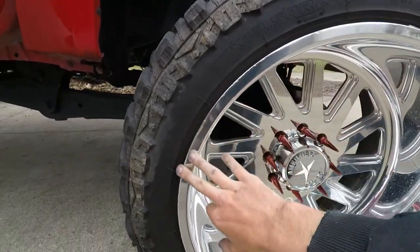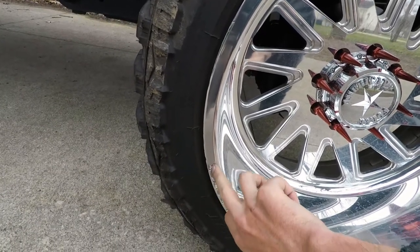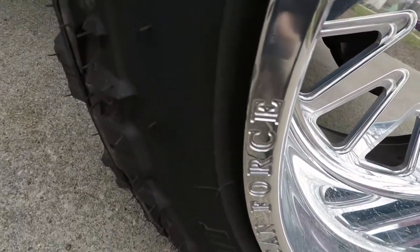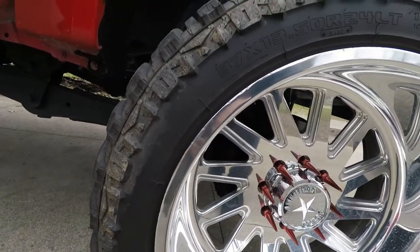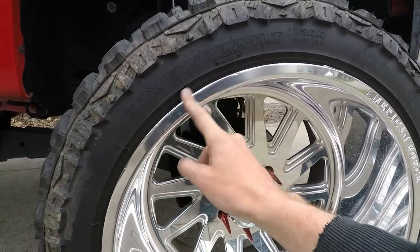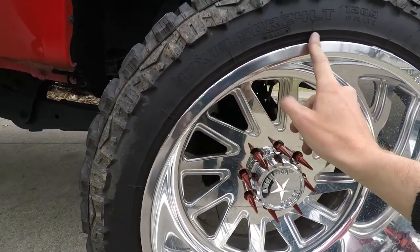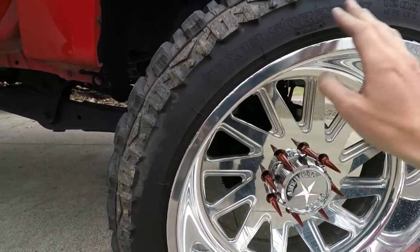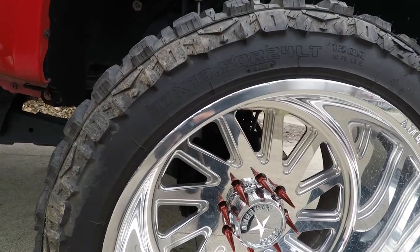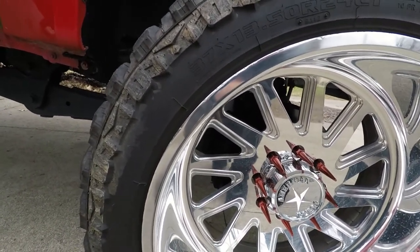You can see I curbed these, and it even got down to where the letters are cut into the wheel, which was scary. Luckily it's not too bad — unless I put the camera right on it you can't really see it, and from five feet away you can't tell. Just be careful if you decide to fix curb rash yourself. I used an air gun with a sander on it and slowly sanded the high parts off, then did the rest by hand with sandpaper, slowly working it down. Then you can polish it back out, same as polishing out fingernail scratches.